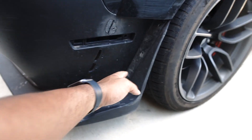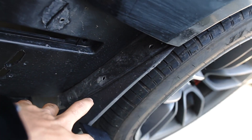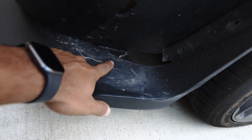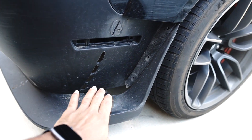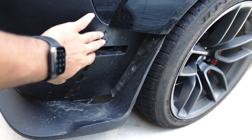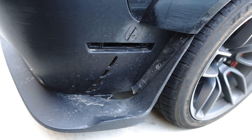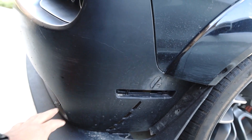What I was running into at first was it sitting too far forward, so it wasn't flushing in because it has this lip on the back side that makes it sit into this lip right in here. There's also a lip at the bottom that makes sure it sits flush. I cut these holes a little too big but I wasn't worried about it because I'm plastic welding to fill the holes — it's plastic so it doesn't really matter that much. It's unpainted right now.